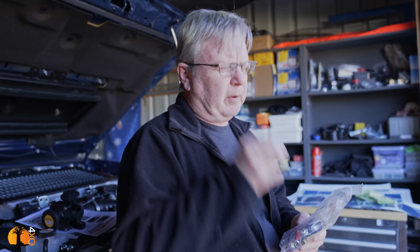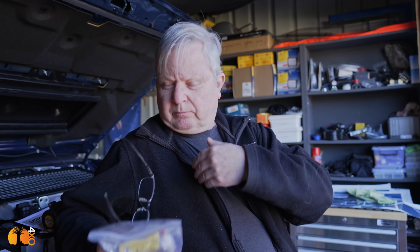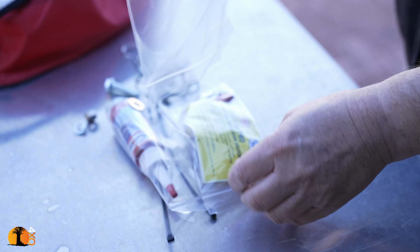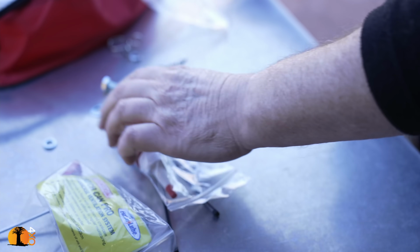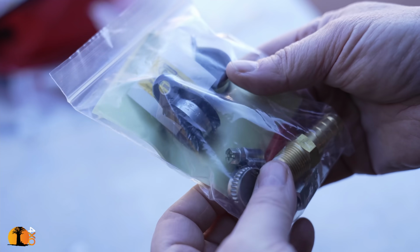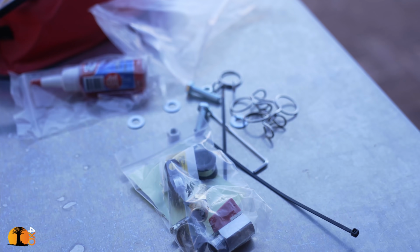On reading up about it and doing research, if you wanted to supply all the kit yourself, you can obviously do that. But there are a few things to make sure of, and that is that the pipes you use must not be a smaller diameter than the manufacturer used, because then you will get constriction, slower air through that part of the system, and that's going to cause problems.